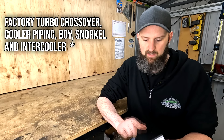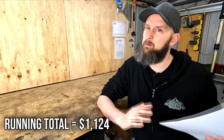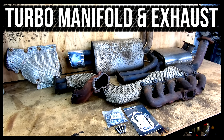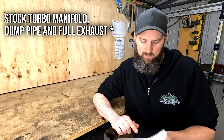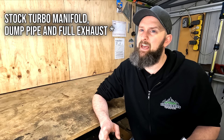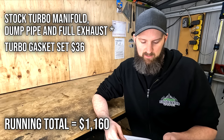I then threw in a new set of spark plugs — factory format items but to suit LPG engines, which have the benefit of coming with a smaller gap already. They were $41. For the intake side we needed an upgraded MAP sensor so the car could read boost. The BA turbo one won't fit our wiring loom; you can get or make a wiring adapter, or just buy a new FG turbo unit which will plug straight in for $83. I removed the vacuum that opens and closes the runners on the NA intake manifold, leaving the runners open and making it very close to the same as the turbo one. From the bulk deal we had the factory crossover, intercooler piping, blow-off valve, larger turbo snorkel, and intercooler. The last really cheap system was the turbo manifold and exhaust. Factory parts are largely pretty good here — standard manifold, dump, heat shields, cat and full exhaust from the turbo. I did buy a gasket set, which should be in the minimum spend — only $36.